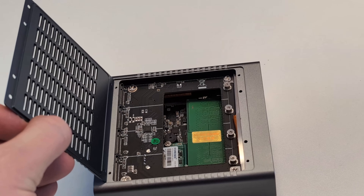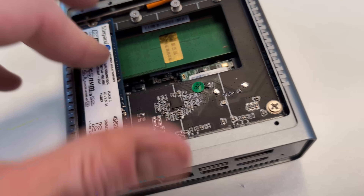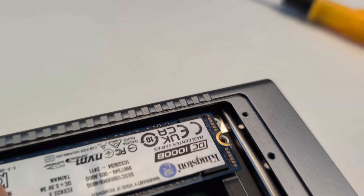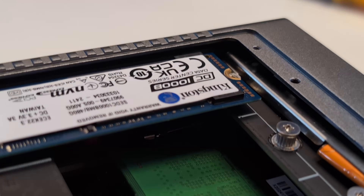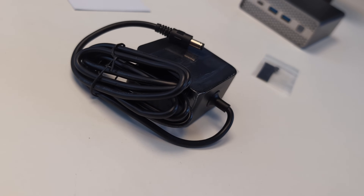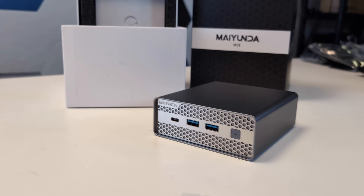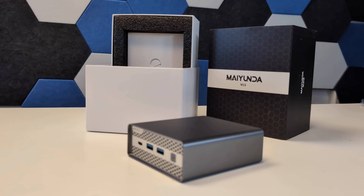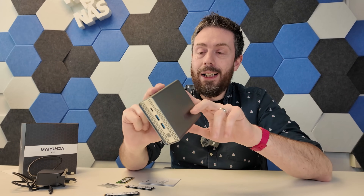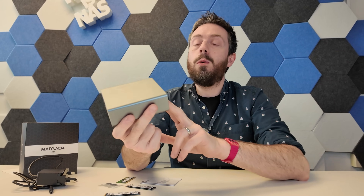So we're still looking at $150 for a four — technically five-bay — flash system. On each of the M.2 NVMes, Gen 3x1 gives a maximum potential of 800 to 900 megabytes per second throughput per drive. One complaint: this system doesn't arrive with any thermal pads. The kit included a couple of extra feet for the base, an instruction manual with no English, and the external PSU — but no thermal pads. At times-one speed, there's a question of how hot they'll get, and that's worth highlighting.